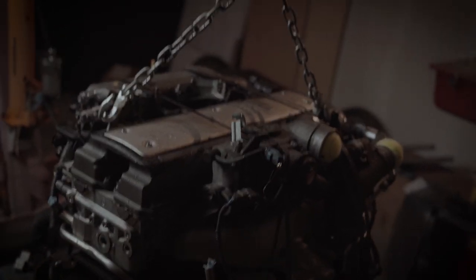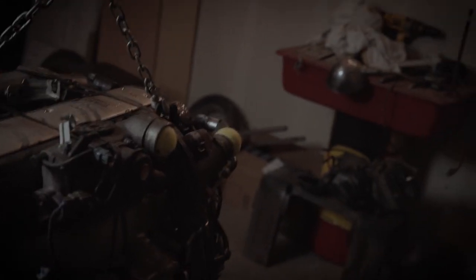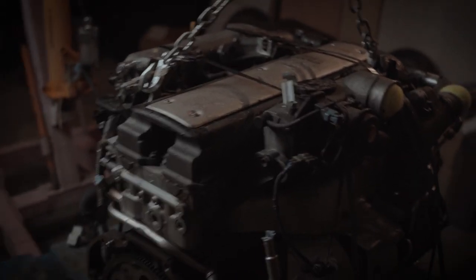I have to drain the oil and do all that stuff, so I'll raise that up pretty high so I can actually reach the underside of it and do the gaskets and all that stuff. So I did get seal packing 103 FIPG that everyone's been saying I need to use. I got that, so that'll be going on with the oil pan. Hopefully there's enough there. So yeah, I'm just gonna get it off the pallet and start looking at the parts for that.